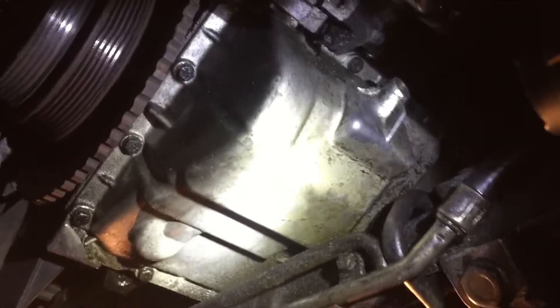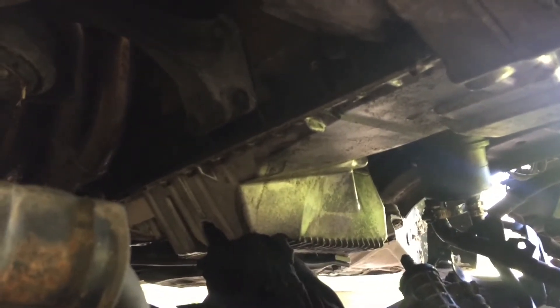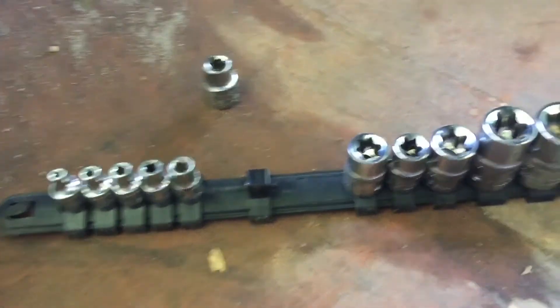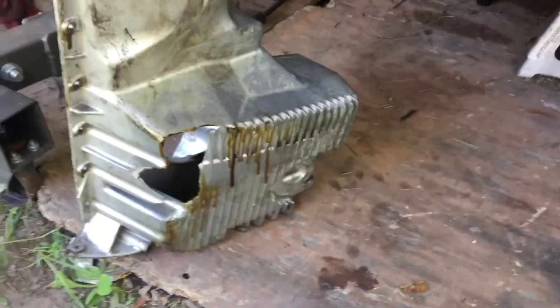It's a new day. I'm dirty but making progress. The rack is suspended and so is the subframe. The sway bar is out of the way. The power steering reservoir and power steering pump are suspended with zip ties. All that's left is to get to the oil pan — and as you can see, it's all exposed finally. I'm also missing some swivel extensions and E-sockets, which are the star sockets needed to remove the bolts at the back where the transmission connects. That's all you need, and then we get to work.